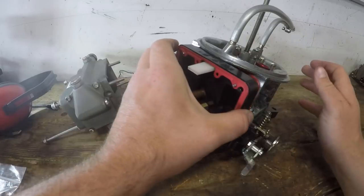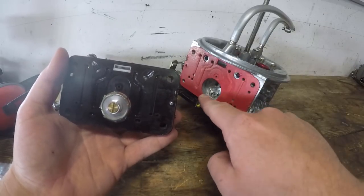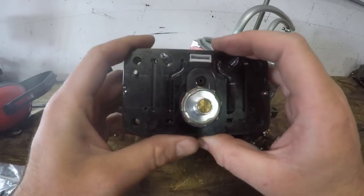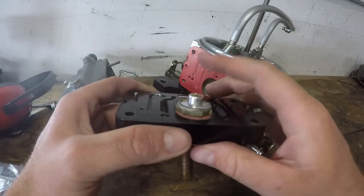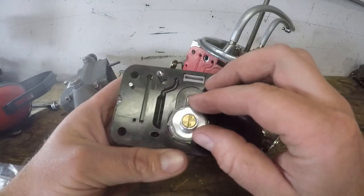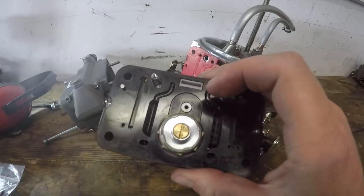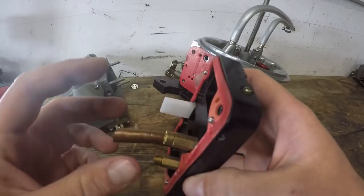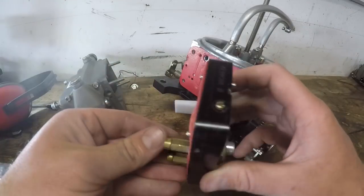There it is — that's installed. That's really all you have to do: plug the hole, grind out the lump, and create your extension. Now with this power valve you can turn this knob to adjust the opening pressure, so it takes more than three pounds to open. This one is on the secondary side, so I'm going to set it up for eight to ten pounds. You can hook up compressed air and test it, or just blow into it from this side — the carburetor provides pressure into the bowl through the tube and that's where it feels the pressure.